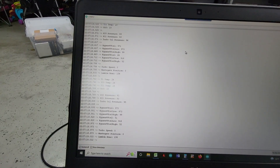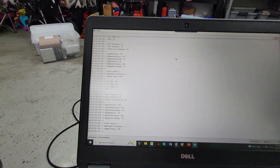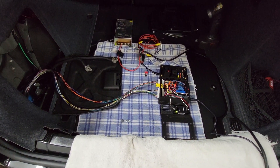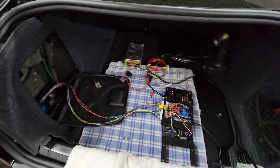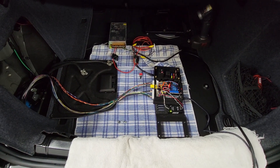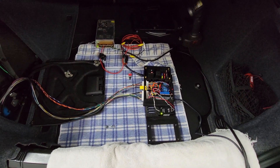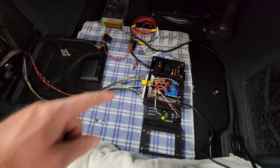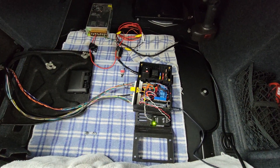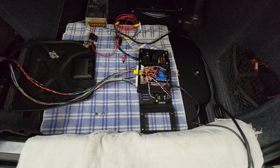That's over six minutes of updates already. Very happy with where things are — just need to finish up the power wiring and get everything mounted back in the rear of the car, then confirm some CAN bus messaging. I'm stoked: I've confirmed over 190 individual wire terminations including the harness and all internal wires on both ends, and easily over 200 if you include the fuse box. Quite a wiring exercise.